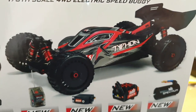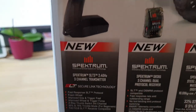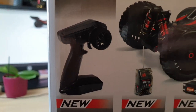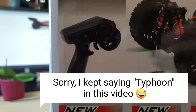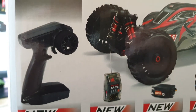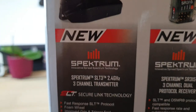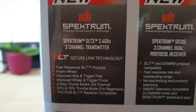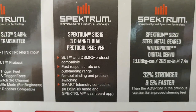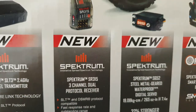It's a very good looking buggy, I have to say. As this is an RTR version, it does come with its own transmitter — the Spektrum SLT3 2.4GHz. I believe this is a much better transmitter compared to the Typhoon version 4. But I probably still won't be using this, because I most likely will pair this Typhoon with my Spektrum DX5 Rugged. So I don't have to carry too many different transmitters with me, but it does come with this one — SLT3 2.4GHz, 3 channels. And it has the SR315 receiver, which is a 3-channel dual protocol receiver, compatible with SLT and DSMR, so that confirms I will be able to use my DX5 Rugged.